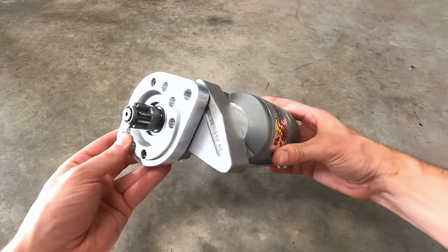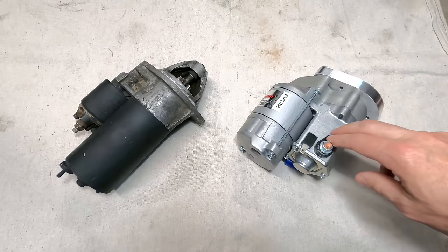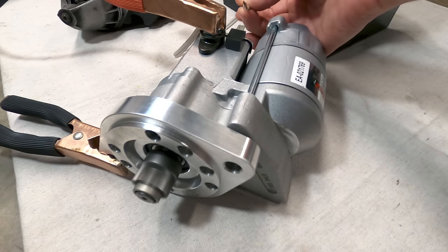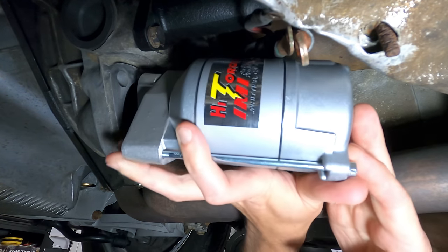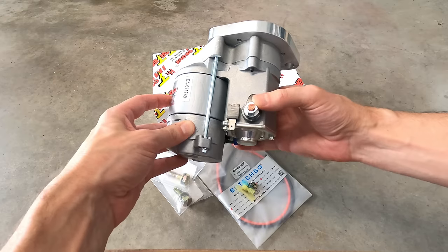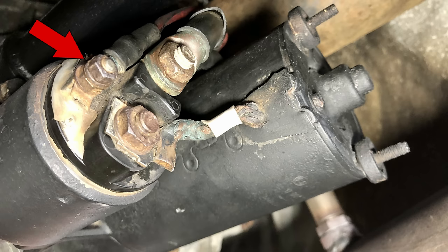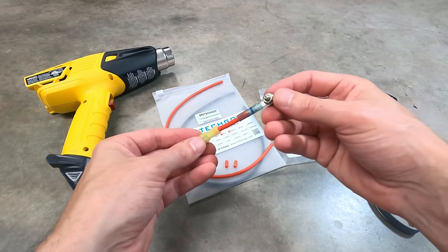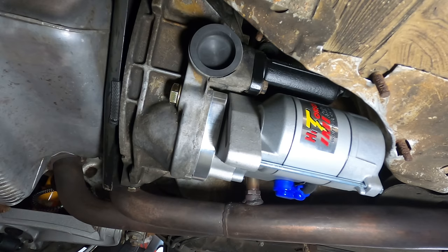A little further below the car is a high-torque starter by IMI Performance, also known as a gear reduction starter. This unit uses offset gearing over the planetary gear reduction of the later OEM starters. The high-torque starter improves engine cranking speed, which conserves energy in the battery to operate other equipment and puts less strain on the charging system. This upgrade is a direct fit replacement on the lower clutch housing, but the starter control circuit connects to a smaller blade-style terminal on the solenoid housing, where the factory wiring features a ring terminal. To preserve the original harness, I made an adapter using some 12-gauge wire and electrical connectors, so it's easily reversible. This modification did provide a noticeable increase in cranking speed, and the new starter has a nice sound to it.